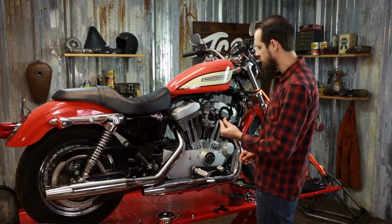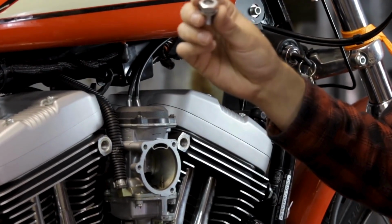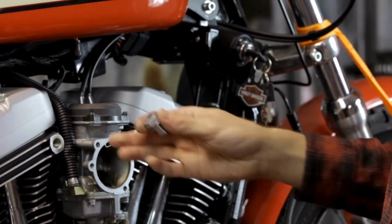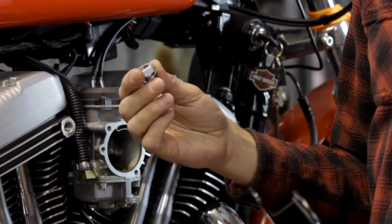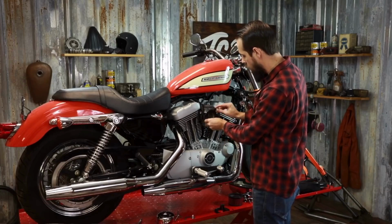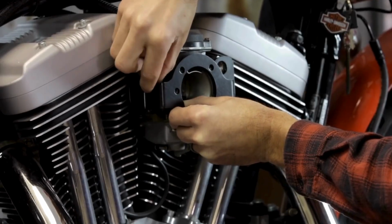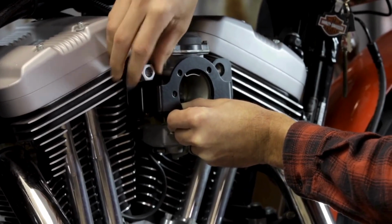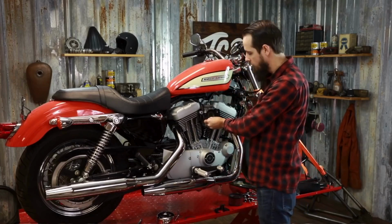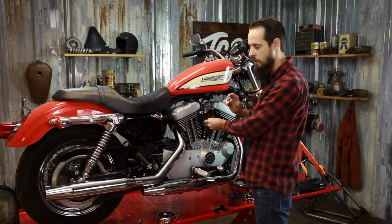The support bracket's attached to the engine using these external breather bolts that we sell. They vent your crankcase pressure to the atmosphere rather than returning it into the carburetor like your original unit did. Simply line up the holes. Start to finger tighten the breathers. Be sure to apply blue medium strength thread locker to all fasteners during this installation.